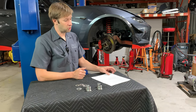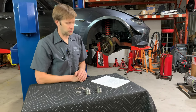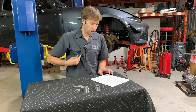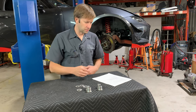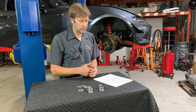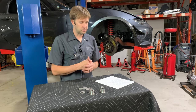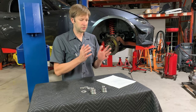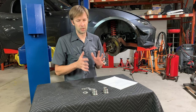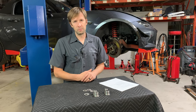In terms of questions — what is the min/max camber with these and what's the gain over stock? You gain about 2.3 degrees over stock, and that should be reasonably accurate. The 3.8 is slightly fuzzy depending on all of your settings, but you should be able to max out at a bit under 4 degrees, basically.